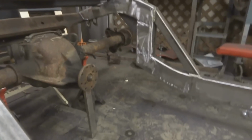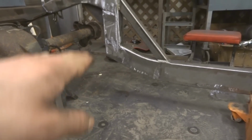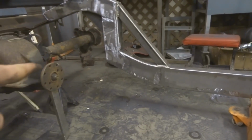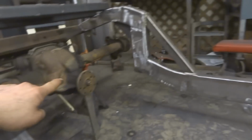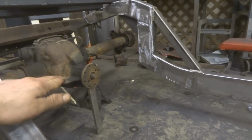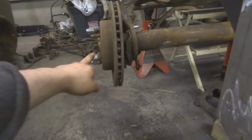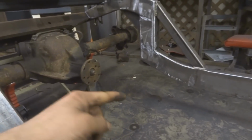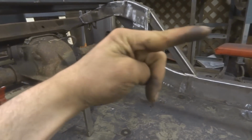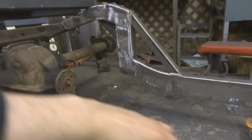As the frame moves up, it'll pull up the car, right? In turn, making the height of the tail shaft a little bit higher, while the rear end is just going to roll. It's not actually going to go up, because this is stationary, because you have a 30-inch tire sitting here at all times. So that's going to actually increase the angle up this way, so it's going to be up like this, and then when it's laid out, it's going to be down like this.